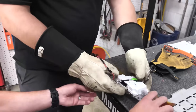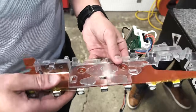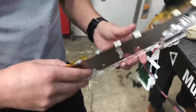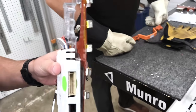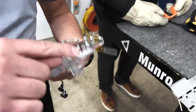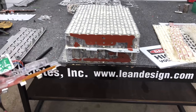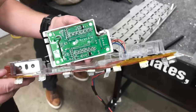One thing that stood out from a DFM — design for manufacturing and design for assembly — perspective, and it also plays into lean design principles in terms of ease of build and simplicity of steps: if you look at all these different layers — the bus bars, this polycarbonate substrate, the BMS board and the attachment of these, which become a little sub-assembly to the side of the battery module — there are no threaded fasteners used. All of these actually use molded-in snap-fit features. This whole sub-assembly snaps into the side of the module via counterparts also in polycarbonate, and even the BMS board itself snaps into features on the polycarbonate. Really happy to see Rivian taking advantage of that and not using a lot of fasteners.